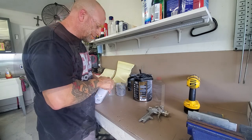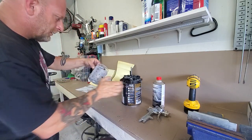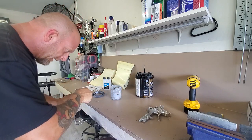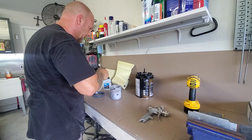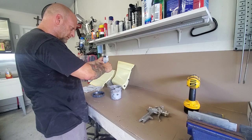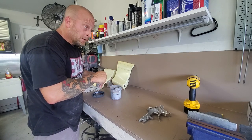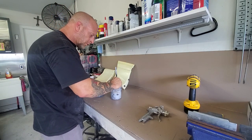It's a two-part product — you need to activate it. We're going to put a good amount of primer on this bumper. I'm going to mix on a 4-to-1 scale — going up to number six on the scale, then even that out with the activator at number six. To spice this up a little bit, I'm going to add a drop of fish eye eliminator to the primer.